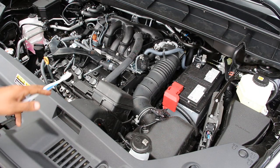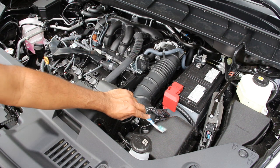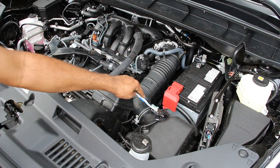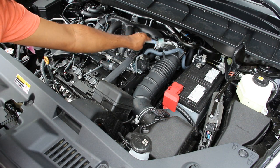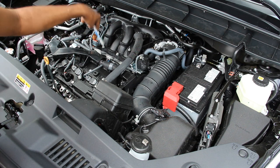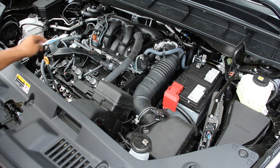Now taking a look at the air intake setup here, we've got cool air that's going to drain down through this tube here that feeds this air box, which has the air filter and the mass airflow sensor. Air is then going to travel through this tube here into the drive-by-wire throttle body, then into a plastic intake plenum, which then feeds into an aluminum air intake manifold which will then bring air into the heads.